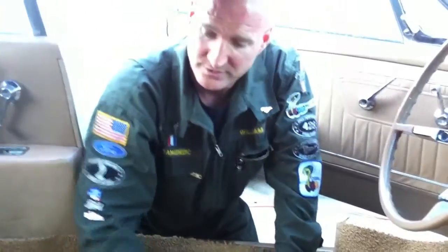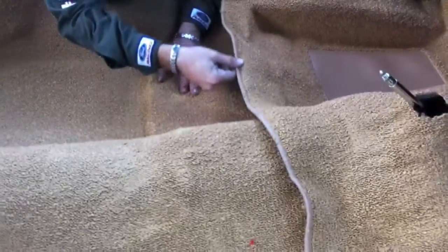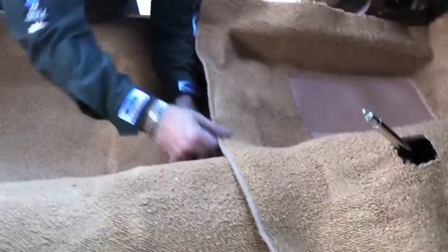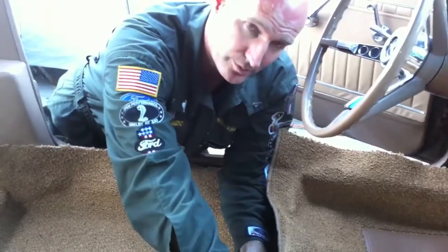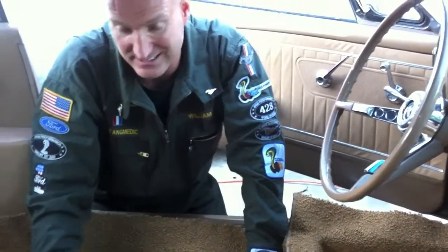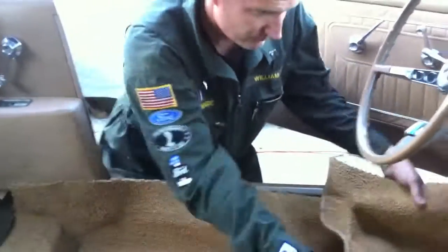The back goes in first because the front has a cosmetic sewn strip - you see this especially when you don't have a center console. The center console is going to hide almost all of this cosmetic strip because the front seats and center console will be over the top of it. I've seen cars where - and this is underneath - they didn't actually notice that this is the pretty part that was facing the wrong way.